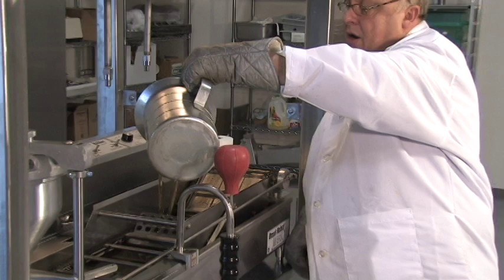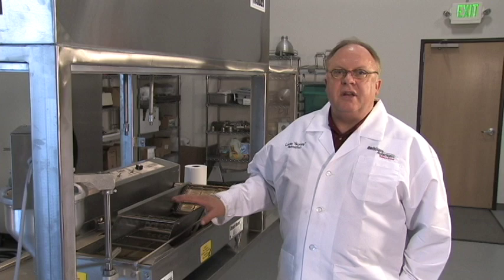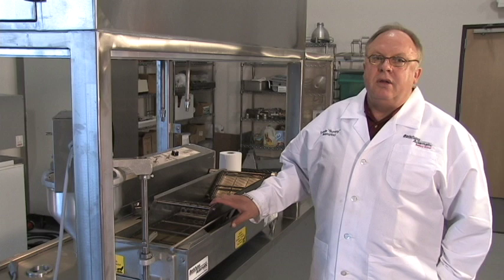Use a safe method to pour the shortening back into the fryer. After some time, you can remove the fryer kettle and the conveyor and clean those thoroughly. You can also carry out an approved boil out procedure to remove stains. If you do, remember never to let any water at all mix with your shortening. The water will boil inside the shortening and that is not safe at all.